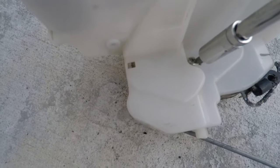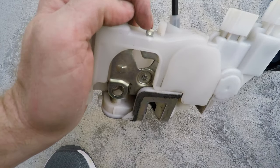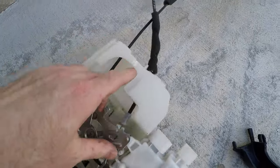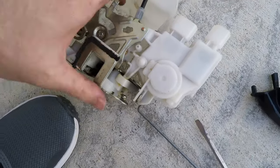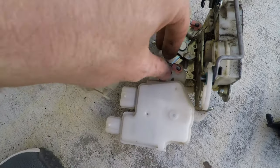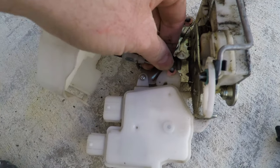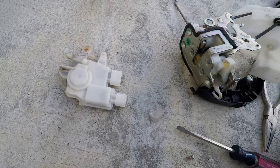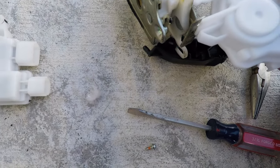There's a screw on the plastic covering that needs to come off, and then the cover can be pried up. This tab is the only thing left holding it down. Once the cover's up the actuator is exposed and ready to be replaced. There's another plastic keeper here that needs to be removed — just unsnap it and release the cable. Remove this small screw, and with that the old actuator slides off the bracket and the new one's ready to go on.